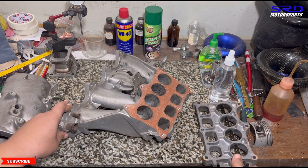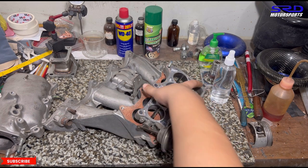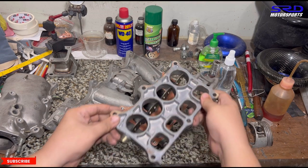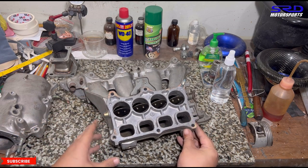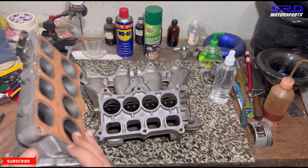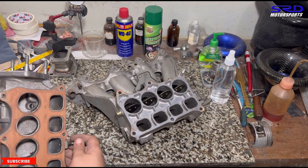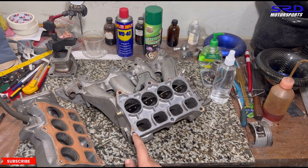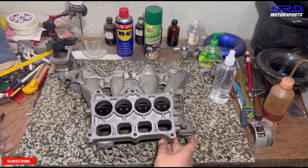You can port this with the intention of keeping the IAB functioning well while making it more efficient. When the IAB is functioning well, you can also increase plenum volume by adding a spacer on top here, which won't be a hassle once it's in the engine bay. Right here this area — you can have a spacer made, and that will naturally increase plenum volume for even more top end.